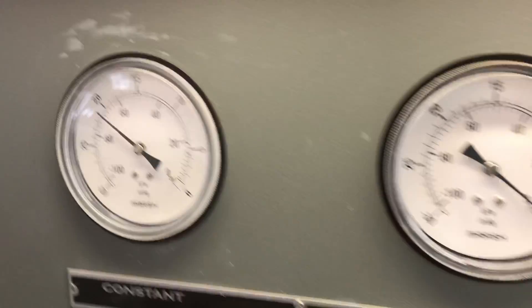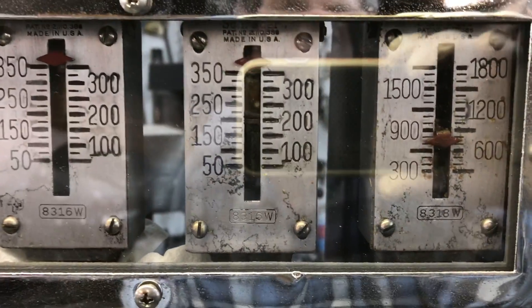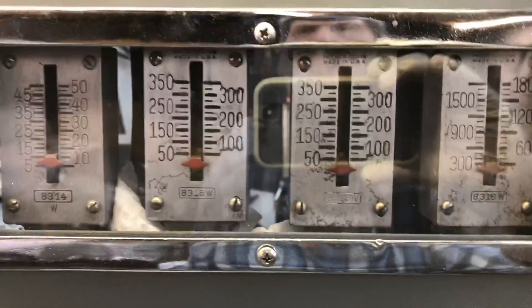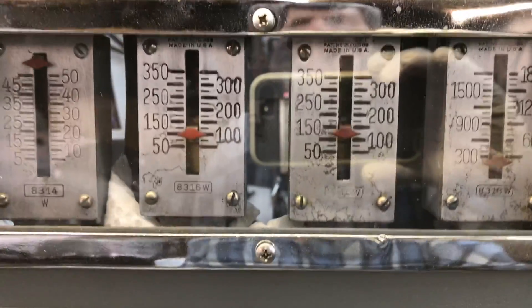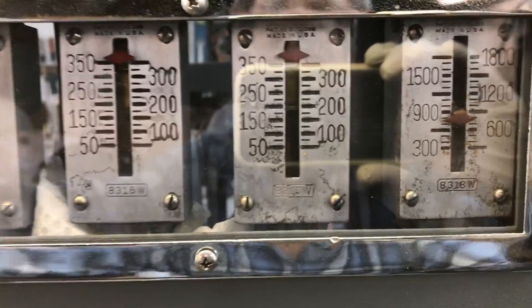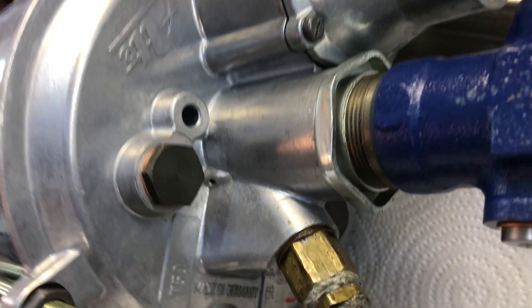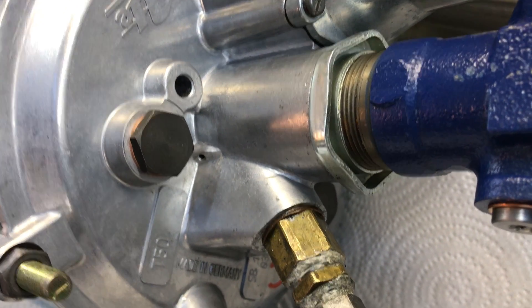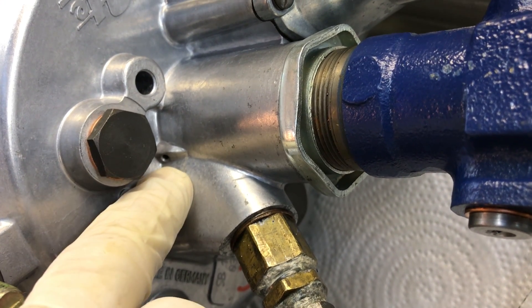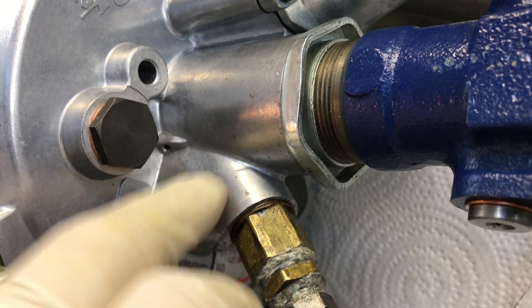Now we check for holding vacuum. There we go — got a good booster. I'll let it sit on the test apparatus for a day or so to check for seepage, just in case, but I don't expect any because this is under 350-plus PSI of pressure inside here, and if anything was going to happen it would have happened by now.